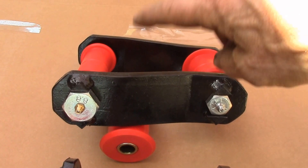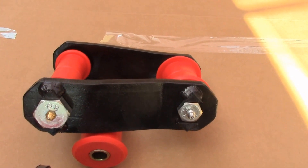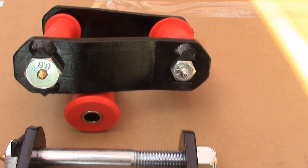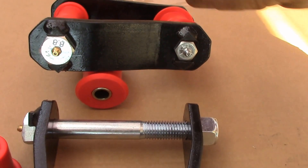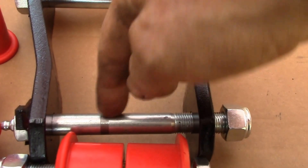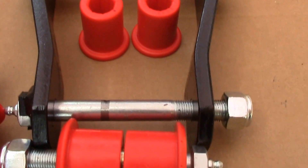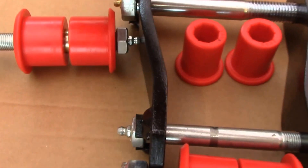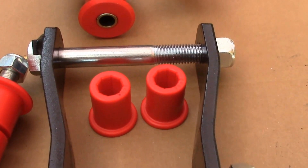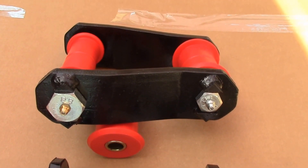We've got the pair of shackles completed. We have the greasable bolts in there — these are for a T100 four-wheel-drive pickup, half-inch overstock — and we have the anti-rotation tabs that hold the head of the bolt and keep it from spinning. Got the spring eye bushings for the rear and front, greasable bolts on the other shackle, and shackle hanger bushings. This is a full rebuild kit for rear springs — change out the spring eye bushings and the shackle hanger bushings in the frame. Greasable bolts all around; that guy should have a brand-new rear spring setup when he's done.